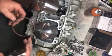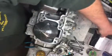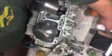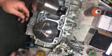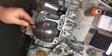This is the PTO side — the mag side is still in the box because that's the magneto side of the ring. These rings go on the PTO piston. Make sure you've got your grooves right, make sure your arrow is pointed to the exhaust port — that's very important — and install your rings.